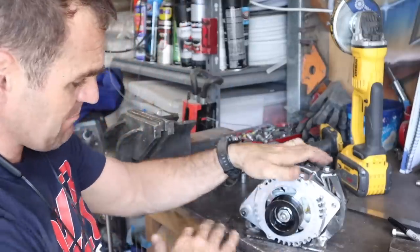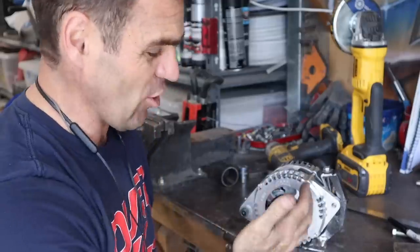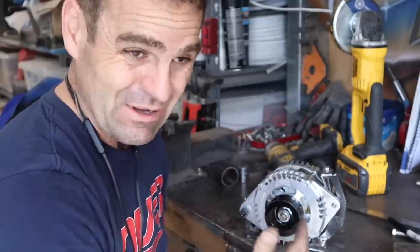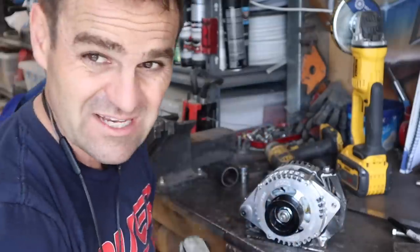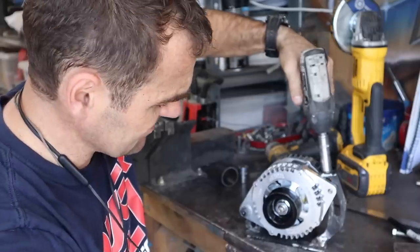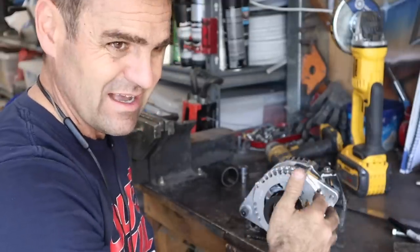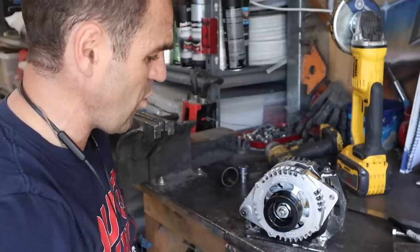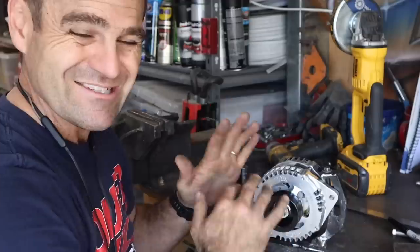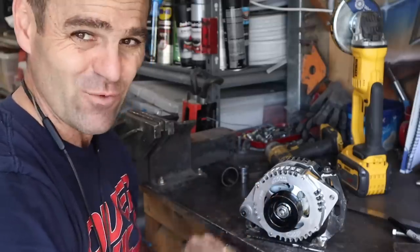We have a working mount for my alternator. It's not pretty — I just reused what I had made up previously. If I did it all again from scratch I would design it up in CAD and it would be much prettier, but it does the job and it's hidden down the bottom of the engine. I took the tensioner off of the Camry and it just screws in and out to tension the belt, and then a bolt on the back locks it into place — double tensioning features. It's got plenty of range of movement and takes up roughly the same dimensional space as the previous one.